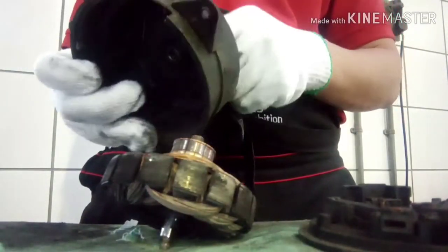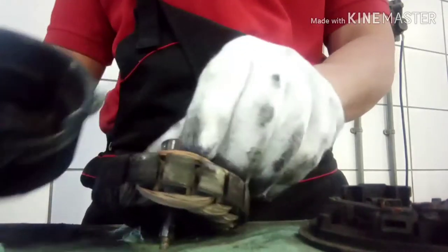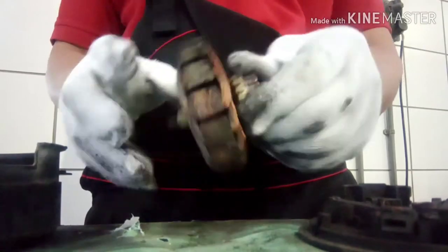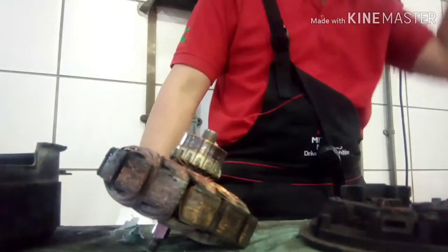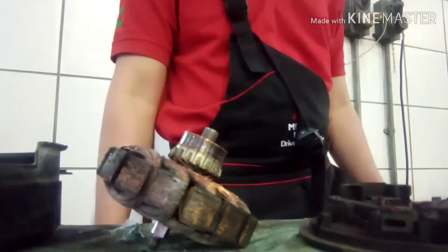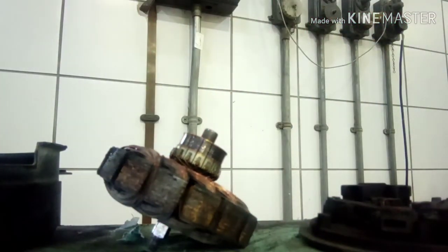This is the condition inside — actually I didn't see any major problem; I can see the carbon brush is already gone. I'm going to clean the motor winding to fix this problem. This is a very expensive part — if you know how to do this yourself, you can save the money from your pocket.